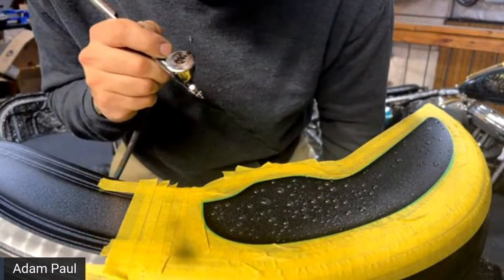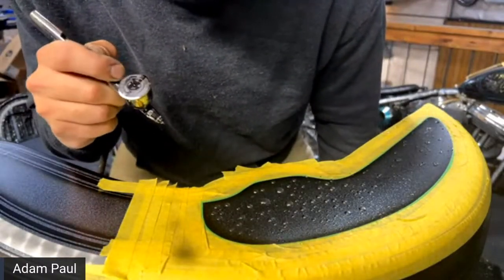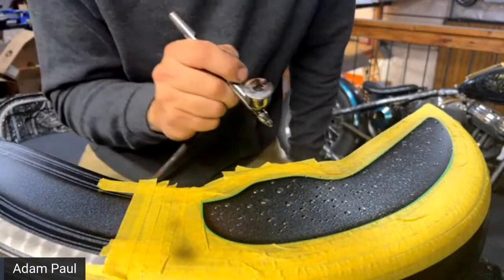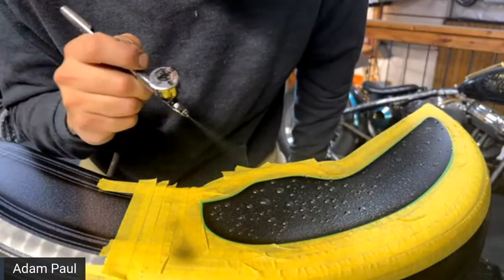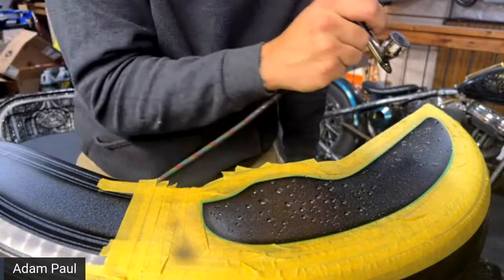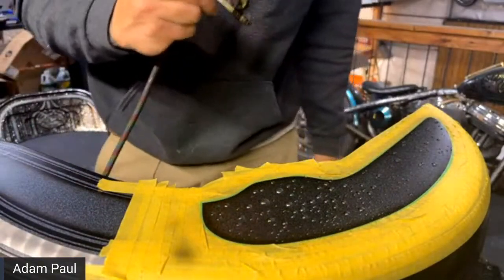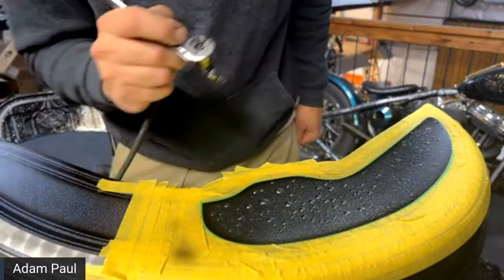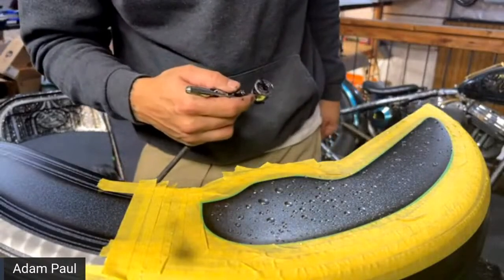Someone said, can you do a candy or overground metal in the future? Yeah, I could probably do that. We would have to see how one of those panels ground out. But sure. Someone's asking what compressor you're using. So I'm using the Iwata Studio compressor, the airbrush compressor, right now. And I use that pretty much anytime I run the airbrush. I used to actually run it to my main line, and you can do that too, your shop line. You just obviously put a regulator in it. You don't blow 50 PSI through this thing.